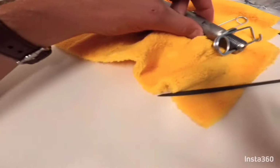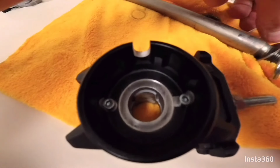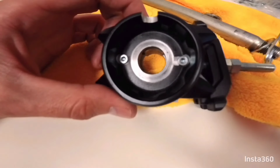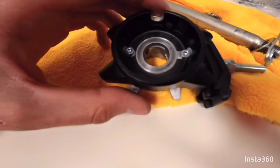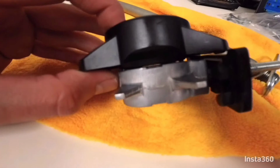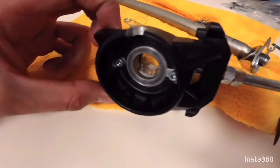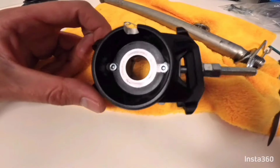And then what I've been working on as well, if I bring them over here, we've got the notch. I machined a notch in there for the pins to be extracted by. And then I've also been working on this, which is an optional thing just for me, for making the tire changes easier. As you can see, I've managed to drill some holes and then tap a thread into the aluminium piece behind. So you can just see the screws in between the two. And what that's hopefully going to do is stop this piece, someone called it a Star Wars looking piece, from just falling on the floor when we remove the axle for changing wheels. And that's just going to help me do a quick wheel change so much easier.